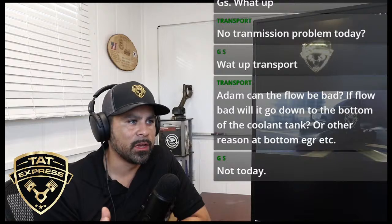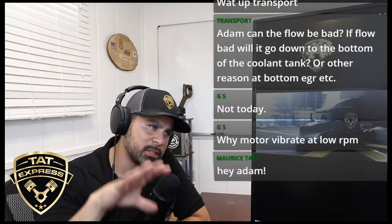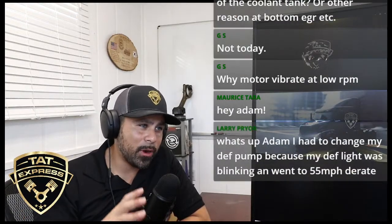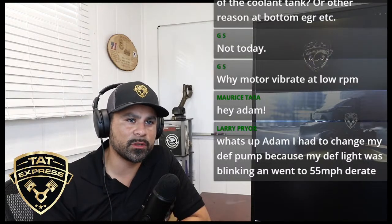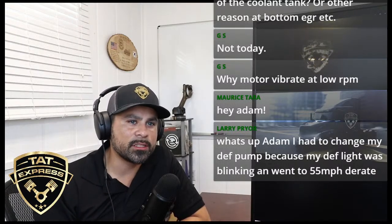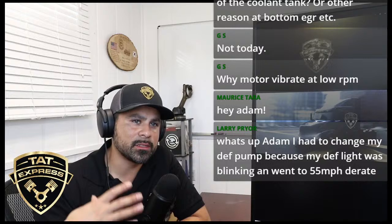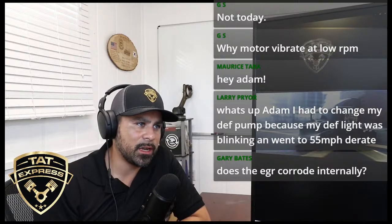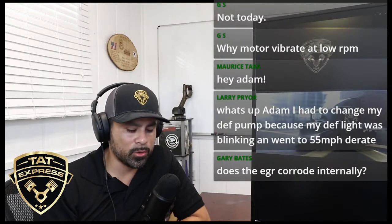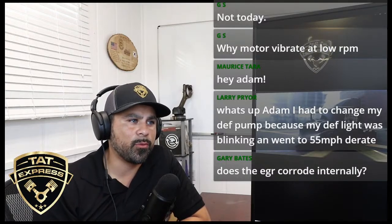Look at the outside stuff. If your radiator hasn't been serviced and you think you've got a lot of corrosion inside it, blow your radiator out. Another thing you can do, when you're running a truck at operating temperature, is look at the coolant temperature differences across your radiator while your fan is on, to see if you have enough temperature drop. If there are big variances, then you can tell the radiator's cooling off. If there's no big variance, then possibly you have a clogged radiator, because coolant goes through that radiator, and the forced air is what cools that coolant off, and it should cool it down quite a bit before going back into that engine.